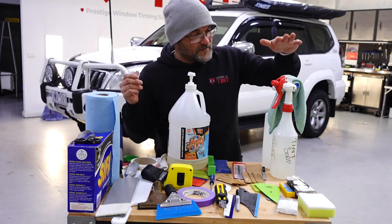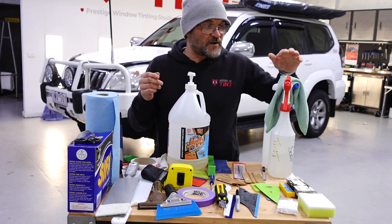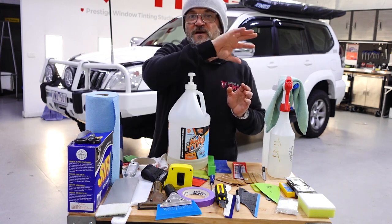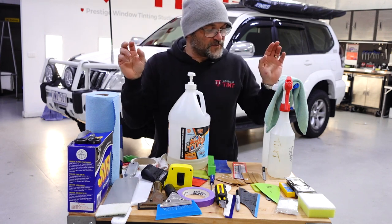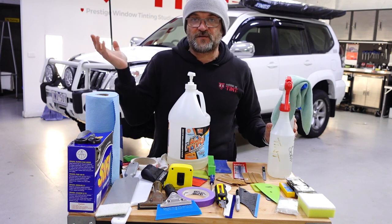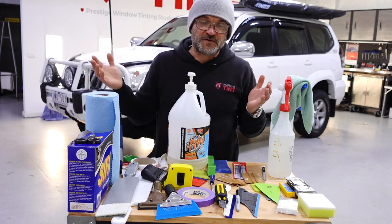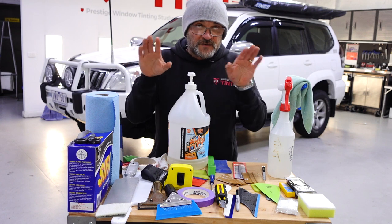With tinting slip solutions, I tend to use two bottles — one for cleaning and one for installing. I use a quite soapy mix when cleaning, just to agitate and help the squeegee rubber glide across the glass without jittering. When doing installs — flushing and peeling the window film — I use a less soapy mix, depending on the climate, whether it's summer or winter, and what particular film I'm using. Some films are quite aggressive with the adhesive so you need to up your soap solution for that.